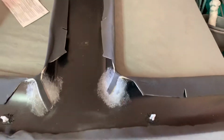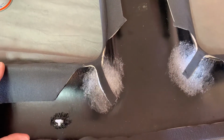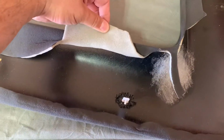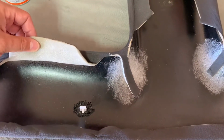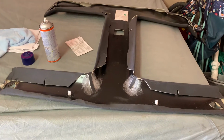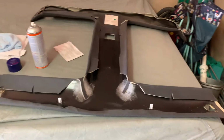So what I did was I took it out, and using my '67 Chevelle as a workbench, bit by bit I'm going along this thing, and more or less everywhere it contacts the headliner on the back side, I'm going along with 80 grit sandpaper and scuffing it up and applying the amount of glue that should be on this thing to hold it. I've recovered these headliners many times, factory ones, both T-top and hardtop. Never had a problem with this. It's something I did notice when I put the headliner in there, but foolishly I overlooked it and figured, hey, for that kind of money it'll hold. I was wrong.